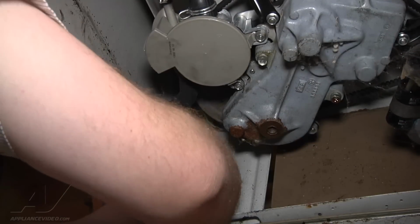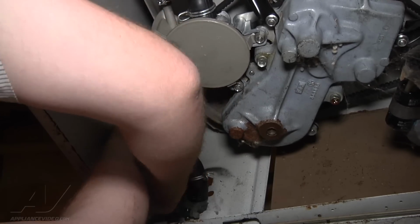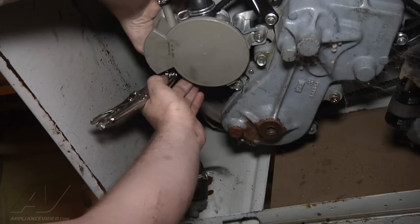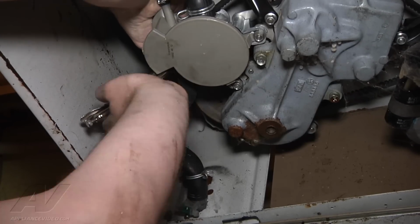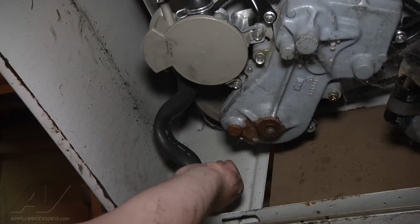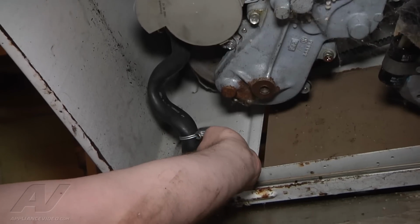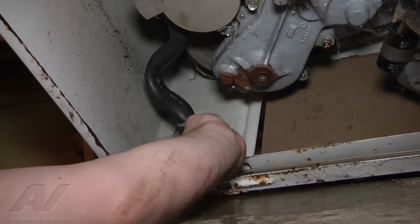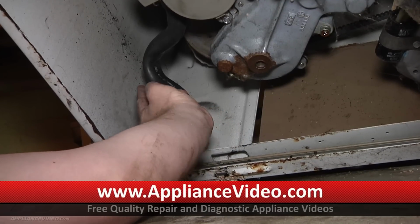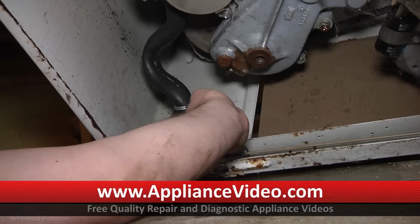Right, so we got the hose adjusted now where all the kinks are out of it, and we can go ahead and put our spring clamps back on. One other thing we noticed was where our drain hose goes to our plastic housing here. On the other side of this is the rest of the drain hose hooked to the other side of this 90-degree fitting that goes to the standpipe. This is disconnected from where it originally was mounted.